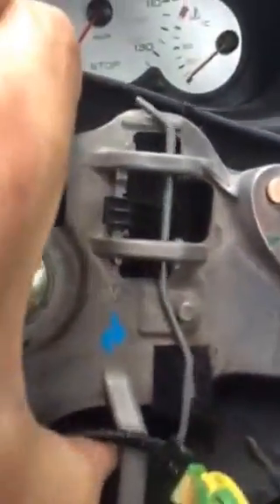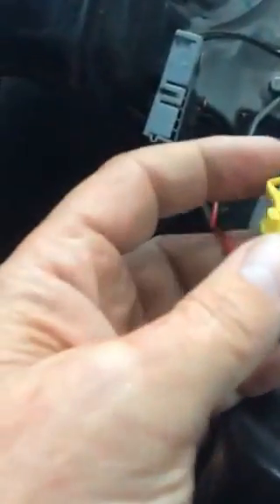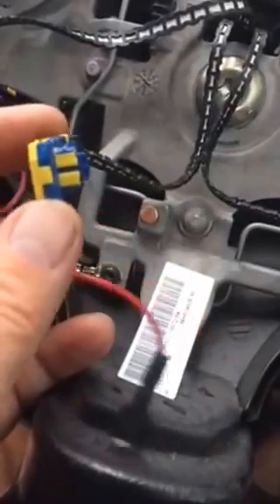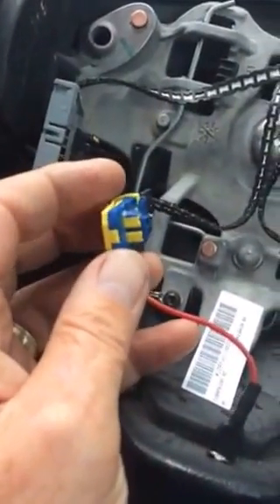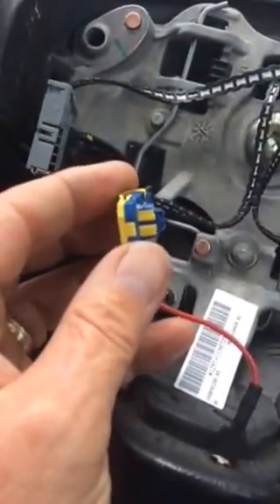There's a hole in the steering wheel and if you push up on that, you'll push that bar there and it will release the clips and allow the airbag to pop forwards. You've then got two connectors to remove. The instructions I've seen say to disconnect the battery before you take these plugs out, and leave it for a good 10 to 20 minutes just to make sure any voltage is discharged throughout the system.